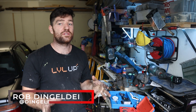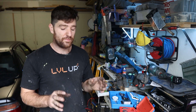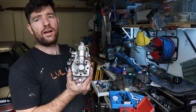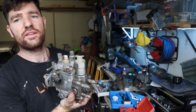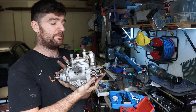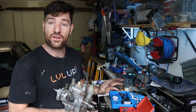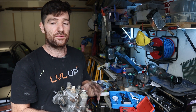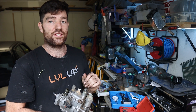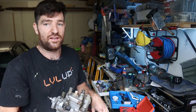I just want to start this video by saying don't buy the specialty tools that you see in other videos, even if it's for a Toyota or a Bosch pump. Yes, this is a Toyota Bosch pump. It may look similar to other things you've seen online, but I've noticed there aren't many videos, if any at all, about the 1KZ pump. I bought all the specialty tools thinking I could get stuck into this, and you don't need them. You just don't need them. If you don't plan on pulling your pump apart, you don't need the tools to time the pump. So I'll jump in to showing you how to do that now, and I'll also show you all these tools that I've bought that I realize I don't need.